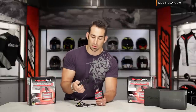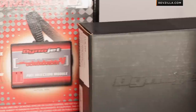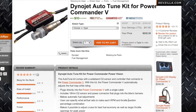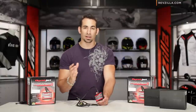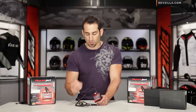You do that by connecting the micro USB from your computer's USB slot into the slot on the side of the unit — and it's really that simple. Once you have the map installed, there are a few things you can do: you can hand-tune that map yourself, or if you're riding a touring bike covering lots of different altitudes where weather conditions and barometric pressure might change, you can also get an auto-tune that plugs into one of the ports on top. The auto-tune micro-tunes the Power Commander based on how you ride and outside conditions as you're changing elevations and as air density changes. Remember, it's all about air-fuel ratio.